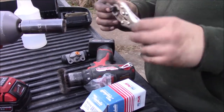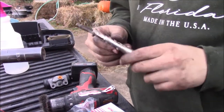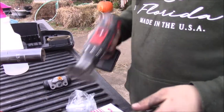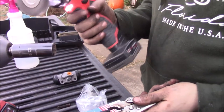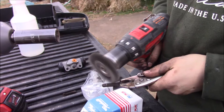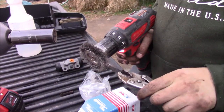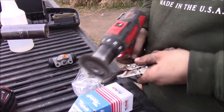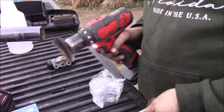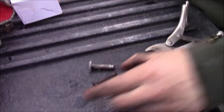These are the things we pulled out of the old wheel cylinder. You can buy these new, but I'm going to be reusing these. Get yourself a wire wheel — you don't have to use a drill, I just like to speed things up. They don't have to be perfect, just get most of the rust and debris off so that you don't mess up your new seals. As you can see, that one is relatively clean — it ain't going to be perfect, but compared to the old one it's pretty good.